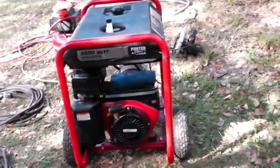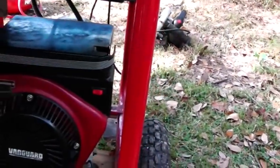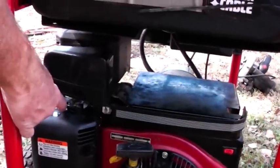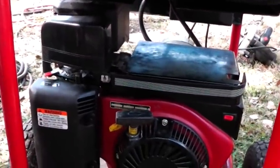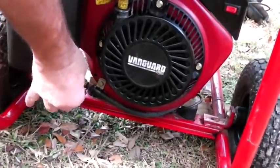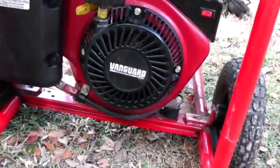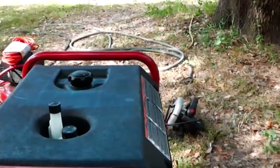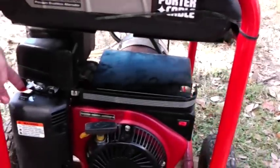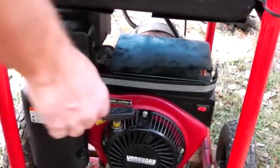It's pretty simple. The first thing you do is put this switch over here to one and put the choke on. This had a real crappy fuel shut-off from the factory — I replaced it and put this brass one on here. You line it that way and that lets the fuel go in. Of course make sure there's fuel in it. If it's cold you put it on choke. Now this one has been running, I've already checked it out, so I'm going to put this back to run and it should start right back up.